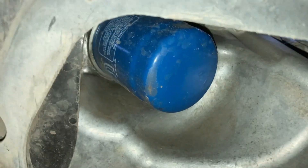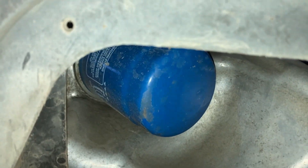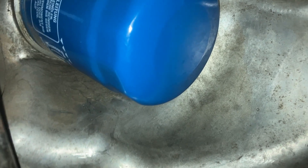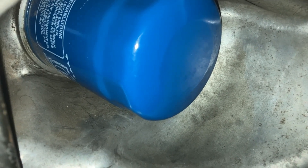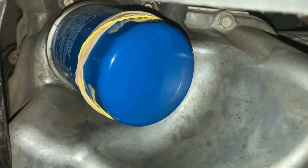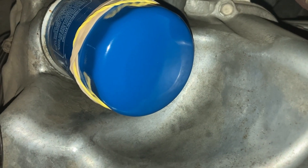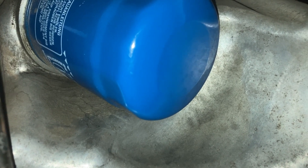One thing I want to do is at least loosen the engine oil filter, which is right here. In the event that I can't open it and need to go to the store to get something like a filter opener, I'm able to do that. Sometimes it is a little bit hard to remove. There are a few things we can do — put a rag around the filter to loosen it, or put some rubber bands around the front end of it. This will help get a better grip on the filter. Or the third option: there are several tools available to help remove the oil filter.